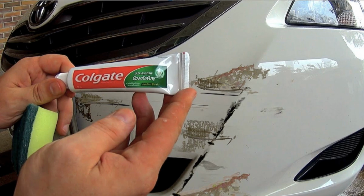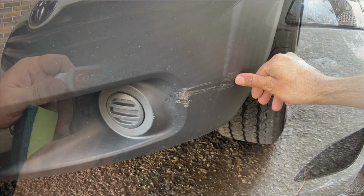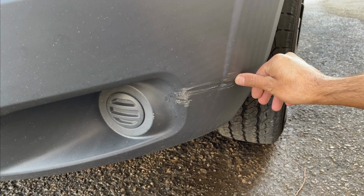9. Repair tears at the back of the fascia. To do this, use fiberglass repair tape. If the damaged area is too large, use masking tape to hold the tear ends together before repairing. 10. Apply adhesive. Use a filling squeegee to spread the adhesive over the tape. Make another layer of tape and adhesive. Let the combination dry until it hardens.